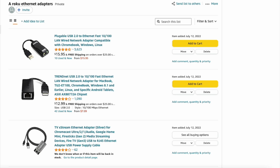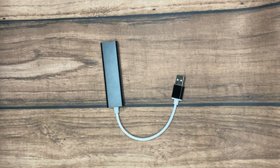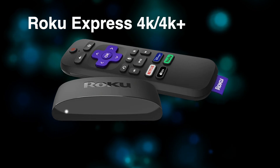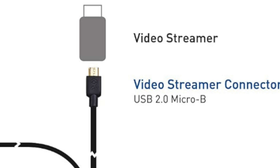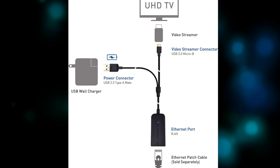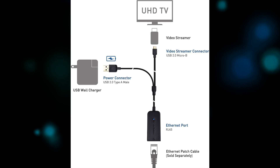All these devices are available on Amazon.com — I'll be adding the links to these products in the video description below. Now, when you get the right ethernet adapter for your Roku device, here's how to connect it to a wired ethernet network. If you own the Roku Express 4K or Express 4K Plus, connect the micro USB end of the ethernet adapter to the Roku streaming stick, and then the USB end to a USB power adapter or one of your TV's USB ports. Then connect the other end of the ethernet adapter to an ethernet cable, which in turn connects to one of the LAN ports of your Wi-Fi router or switch.